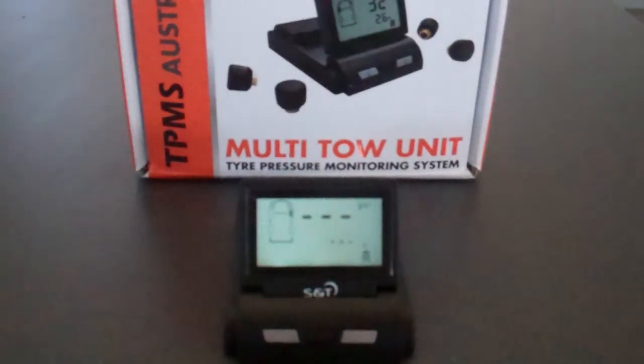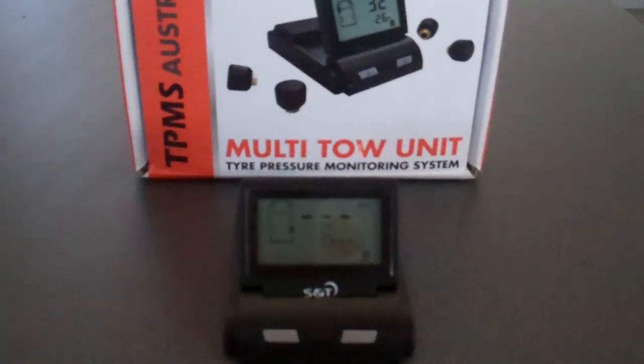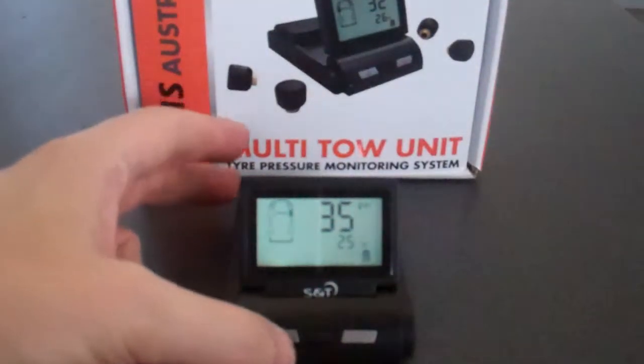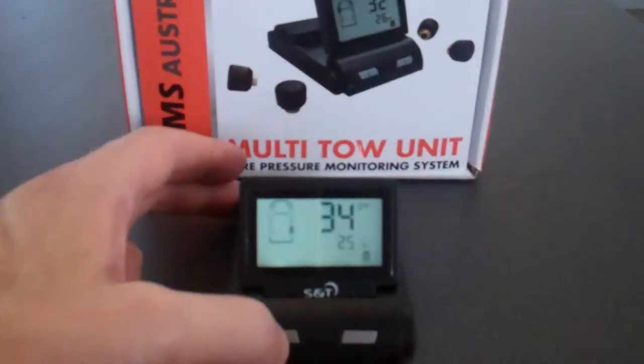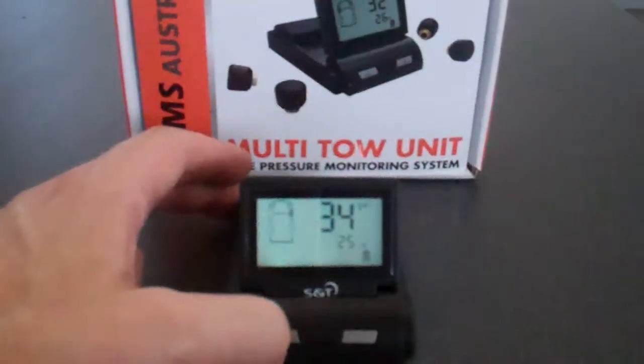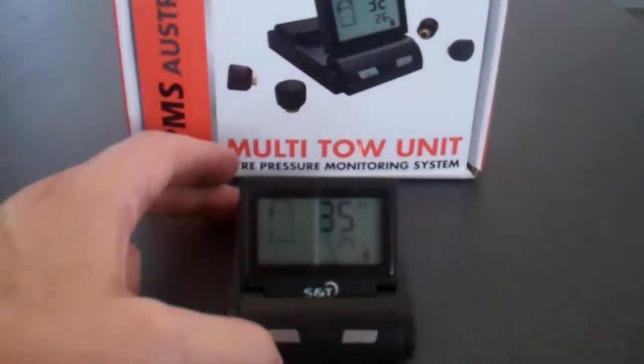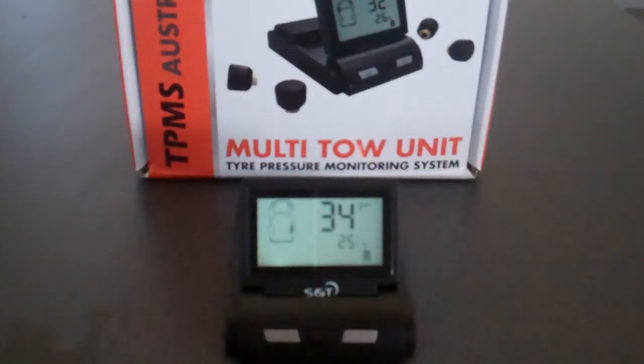While it's scrolling around there, we'll actually tighten these four transmitters up on the rim I've got here, and you'll actually see that the monitor will pick them up. There's 35 psi in this wheel. As I tighten them up one by one onto the valve stem, you'll see that the unit is actually picking them up. We've got 35 front left, front right 34, rear left 34, rear right 34. I'm happy that there's a one psi difference — that shows you it's not staged. The error rate is one to one and a half psi, so with a one psi difference, that's acceptable.